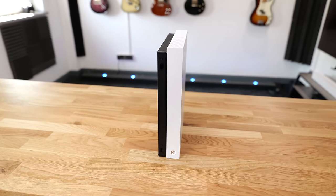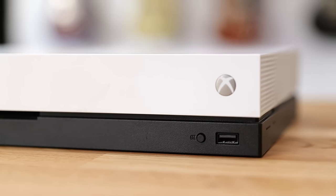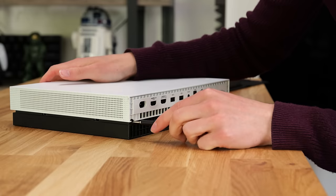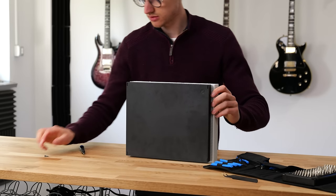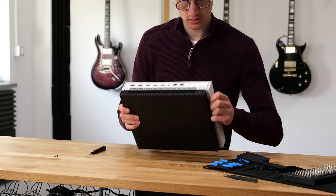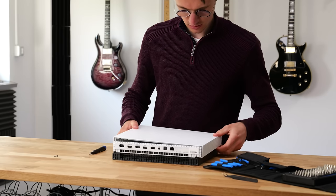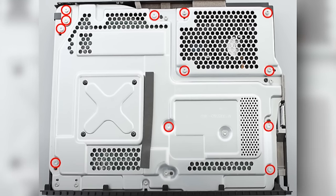The process of upgrading the SSD within your Xbox One is pretty straightforward. The console I'm using is the Xbox One X, which is probably one of the easiest Xbox consoles to take apart. First, remove the two rear screws at the back — do bear in mind this will void any remaining warranty as you remove those stickers and break the seal. Then the top cover will just easily slide away, and you remove the various screws at the top highlighted in the red circles.